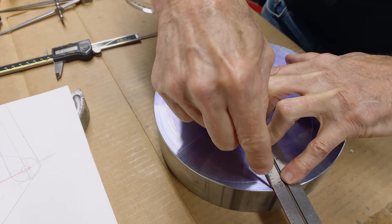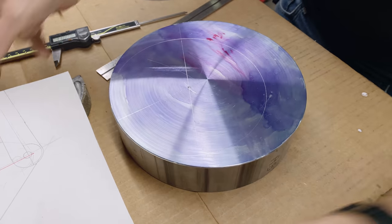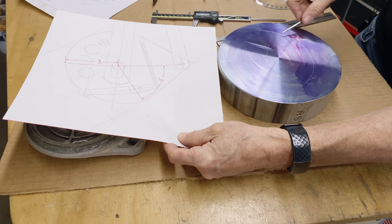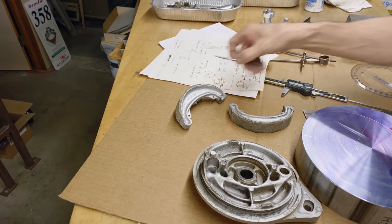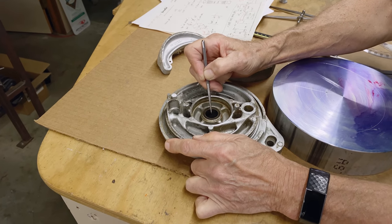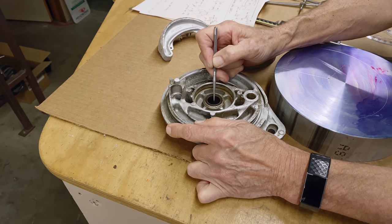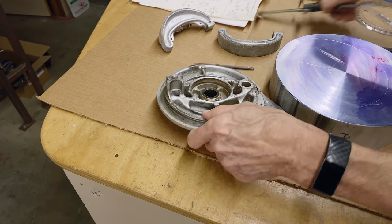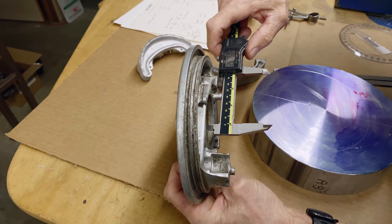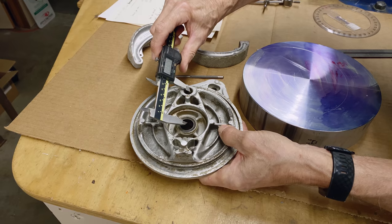That's my center line — this is the crucial line. This has to be opposite that, and that looks right because this is 65 degrees from here to here. On the backing plate, what's really crucial is the distance from the axle out to the hole. I'm making an assumption that it's the same spacing. I measured from here to here, and then from here to here. I take those two measurements, add them up, and divide by two — that gives me center to center.